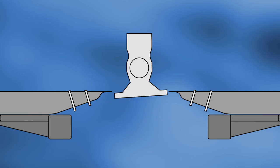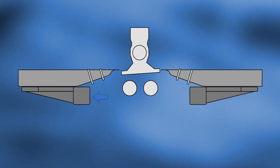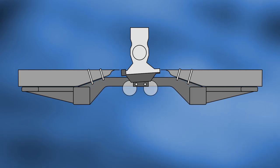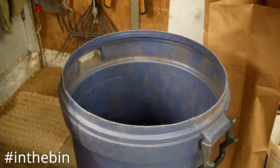This is a cross section of the transmission and its built-in mounting boss, which you may notice is on a bit of an awkward angle. And lastly, these are a couple of two-and-a-half inch exhaust pipes. Ideally they'd be located further apart, but the lack of space for the rest of the system means they'll have to be closer together. So the task is to join all these points while avoiding the exhaust pipes. That factory Mustang mount is shaped in a way we hoped to modify, but seeing it now it's pretty obvious that's not going to happen — it's just too tall to fit above the exhaust. So, perhaps predictably, we're going to have to make one.